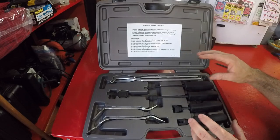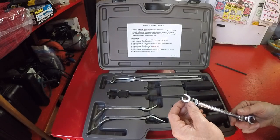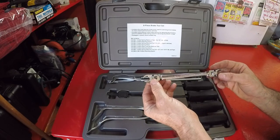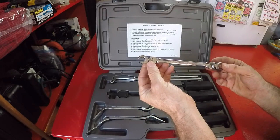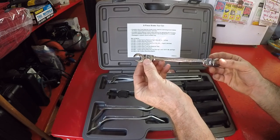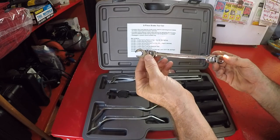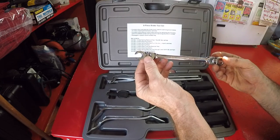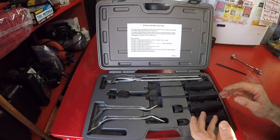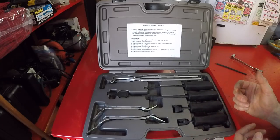If you want to replace your wheel cylinders or bleed your brakes at the same time, a 10-millimeter flare nut wrench is highly recommended. If you use an open-end wrench you run the risk of rounding off the flare nut fitting. Always use a flare nut wrench on flare nut fittings — it's the best way to limit your chances of stripping a fitting. That's all the specialty tools we'll use, other than a DeWalt impact gun to remove the wheels.